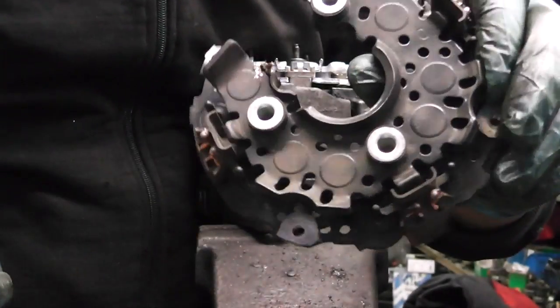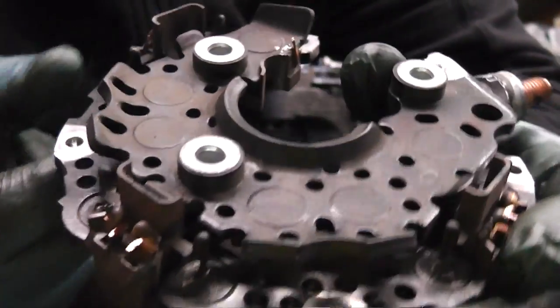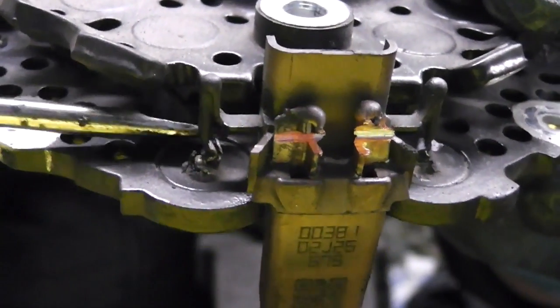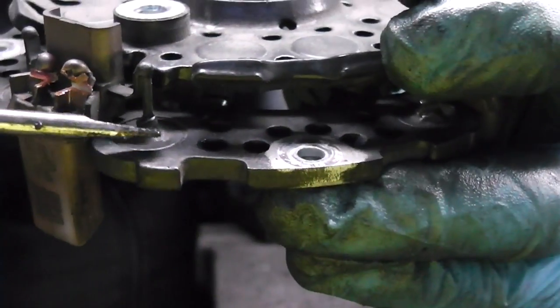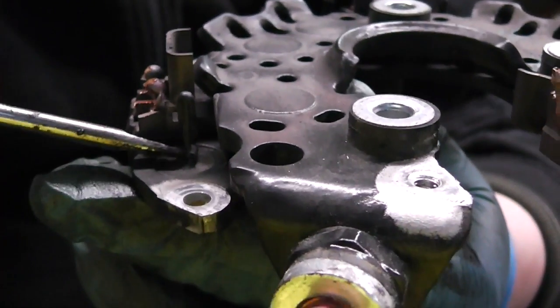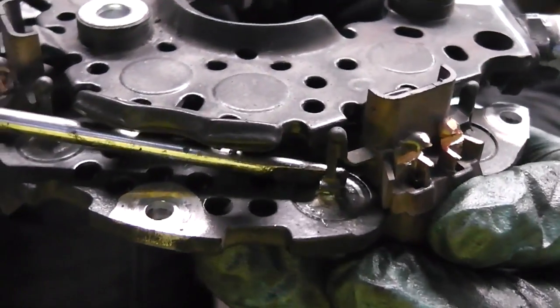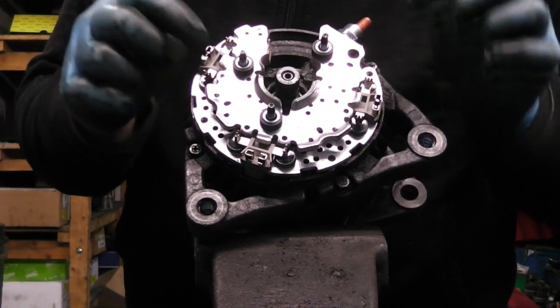If you're not 100% sure the rectifier is your problem, just after pulling the black cover off, have a good look at the diodes. Often at the bottom of a diode you can see it's badly burnt out — the paint is peeling off. In comparison, a good diode has a nice, even surface with no burnt marks. If you take a screwdriver to a bad diode, any pressure will simply break them off.